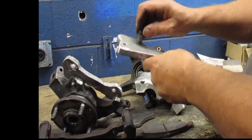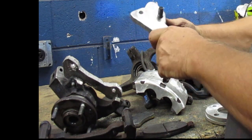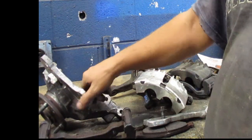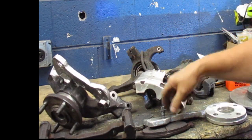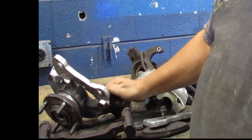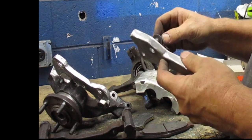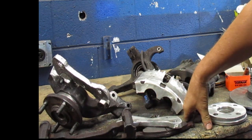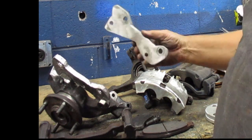You don't want to elongate the holes — they've got to be a solid fit. For the mounting to the actual hub, you can crank down on them and they're not going to move too much, but there's no slop in those mounting holes either. The critical thing is that the mounting plate holes are a pretty good fit.